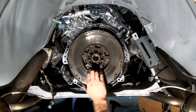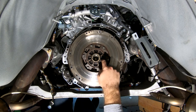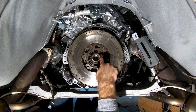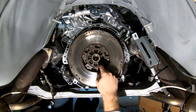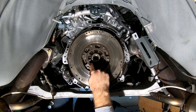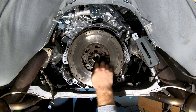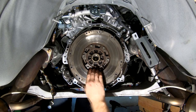With that clutch off, it reveals our flywheel. To remove this, there are a total of eight T55 Torx bolts. I'd recommend getting a three quarter inch or half inch drive with a T55 Torx on the end of it. Now the flywheel — if you try and put a lot of torque on these to take them off, it's most likely going to want to spin. I can kind of move it with my hand a little bit, but you want to be able to hold it in place.